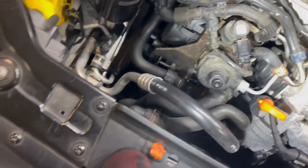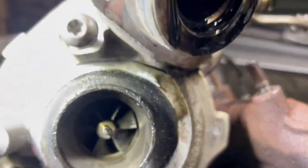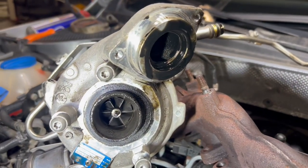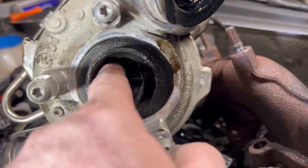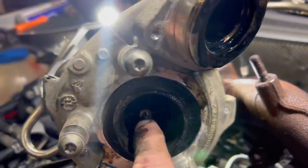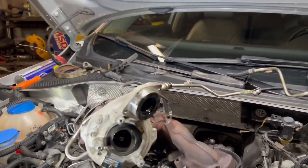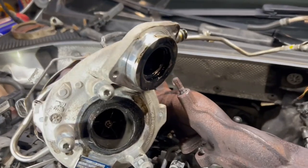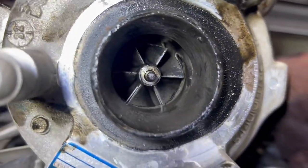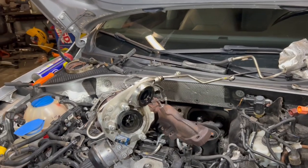The turbo is all one piece of course. Brian found a problem — the nut came loose. There's your nut. It's kind of beat up. See if the compressor wheel is moving as I shake this. That's negative boost right here — it is broken. What happened: it locked up and then it broke the shaft. The shaft locked up and then it turned itself off. That's a good thing it didn't go into the intercooler or into the motor. The turbo is trash.